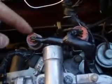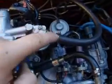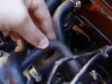Next are the sensors, two of them, one for TPS and another ISC. Next is the two injector plugs for both injectors, which is only two as I'm pointing at them. And also the fuel return hose held on by just a hose clamp. Next is a water coolant bypass hose from the throttle body to the intake manifold. Lastly, 3 vacuum hoses, which is black in color and rubber.